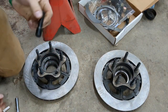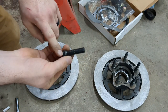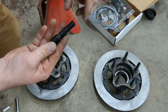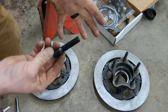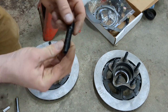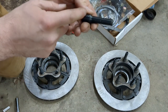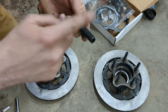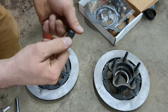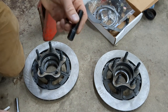Now we're going ahead and installing new studs. The studs that came with this kit were 5/8ths — 5/8ths fine thread on the hub side and 5/8ths coarse thread for the lug nut. They'd work well with race car wheels, but we didn't want to drill out the American Racing wheels on the truck. So Speedway Motors offers this kit that goes from the 5/8ths stud for the Grand National hub to half-inch-on-20, half-inch fine thread. This seemed like a much better option than drilling the wheels out, especially for the $68 it cost. So I'll put a little thread locker on them and run them in.